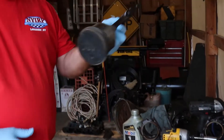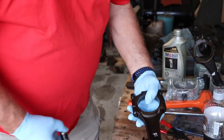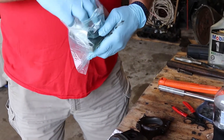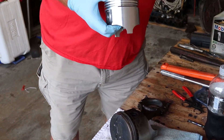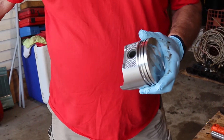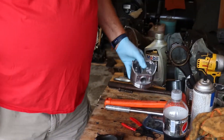Hello, we're continuing on putting the pistons in this motor. First we're going to take an old piston off of a connecting rod and put a new piston on. Here is an old piston, and these are the new pistons. You're probably asking why am I putting new pistons in — well because we punched this out 30 over, larger than the stock piston. If we would put these pistons in, they'd be just slopping around in there, so you have to put new pistons on it.